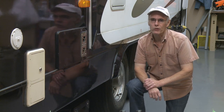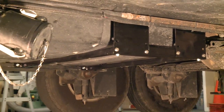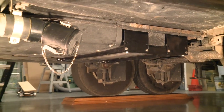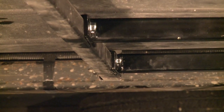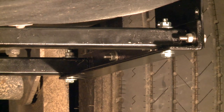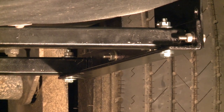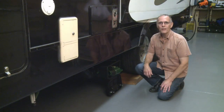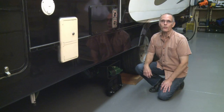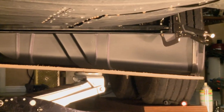Here's a look at how that worked out. I made up two lengths of one-inch steel thin-wall tube and had my friendly welder weld on a couple of flat pieces, which allow me to bolt them to my original tube running front to back. The other end of these tubes rests on the angle piece, as seen here. These tubes are spaced out to match up with the width of the storage box. Now it's just a matter of screwing the box up to these one-inch tubes. This has allowed me to mount the storage box as high as possible to the holding tank cover, keeping as much ground clearance as possible.